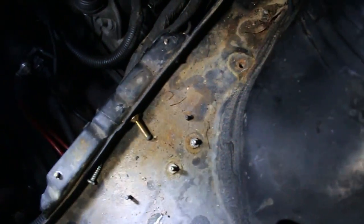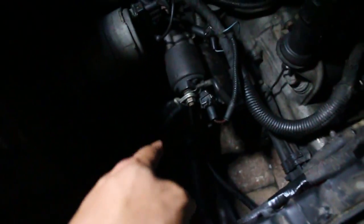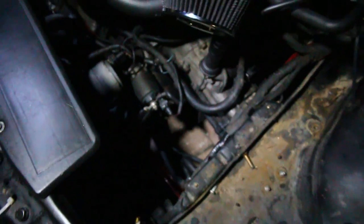All you really need for this is the power distributor, run your lines to your starter, you need one line to go to the rear, hook your ground from the front to the frame, and then obviously you need the terminals and stuff — but it wasn't too hard to do. Took us a little while because we were trying to do things nice, but overall pretty simple.